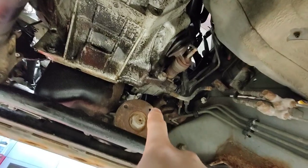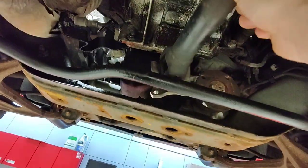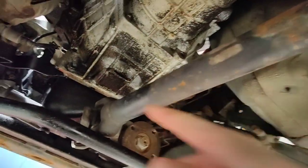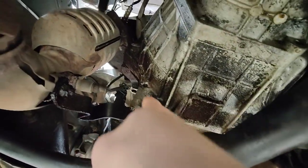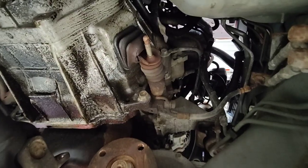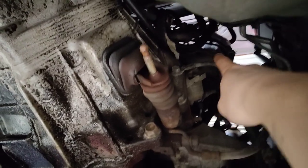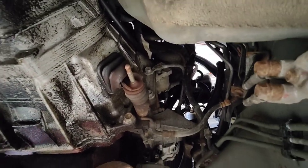I readjusted my arm so I'm not covering these bolts because I got to remove this crossmember. I removed the front drive shaft and slid it to this side. I think I might have to pull out the sway bar to slide it out, but we'll see. There's a couple bolts around the bell housing — get myself a tranny jack, disconnect the slave cylinder, and there's a ground up there.